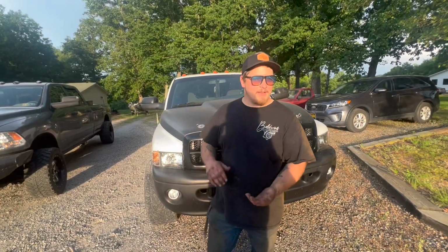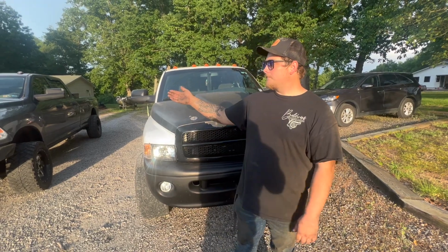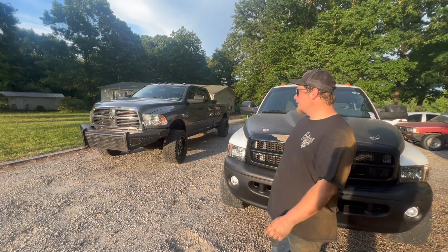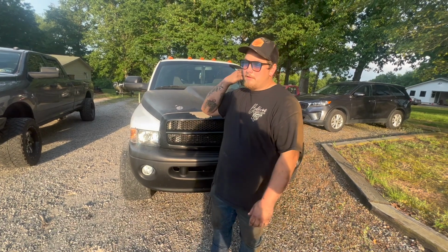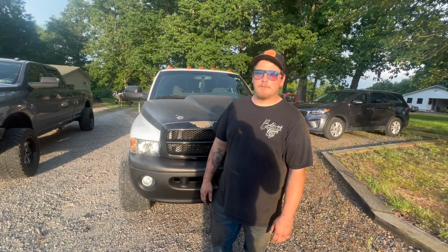All right guys. So as you've seen, everything went pretty good. Everything went smooth. Only thing different we had to adjust was the throw-out on the clutch. We should have video of that as well. So other than that, we can go over his truck a little bit. It's a 2012 6.7, it's got a Fleece 467 second gen swap on it, built G56 as you've seen, and five position switch tune. Of course, it's got a weight loss program on it, but yeah.